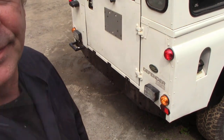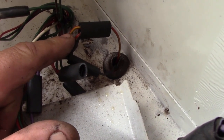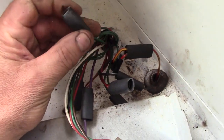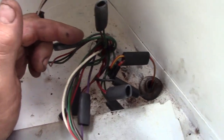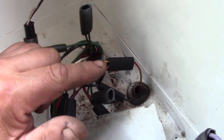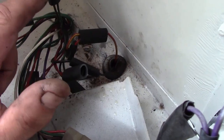The next thing we've got to do is go inside the car and swap a wire over. This has got to be the easiest job ever. These are the wires for the fog light — the red with the yellow tracer. These wires here, the green with the brown tracer, are for the reverse light. It all comes up through the right hand side and doubles back, so we can take advantage of that. Take that connector out and push it into there.